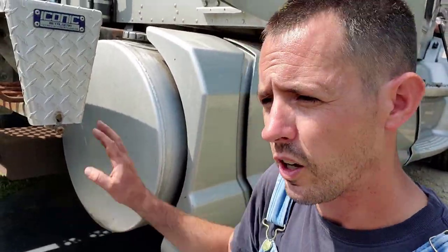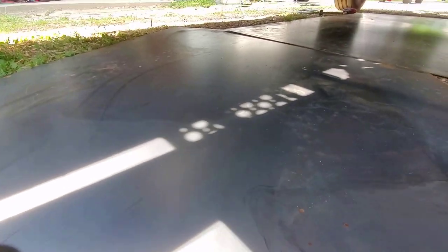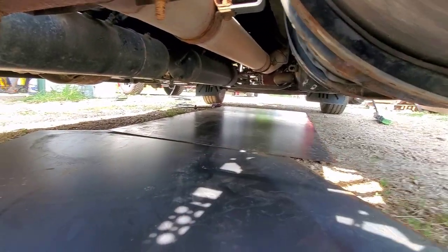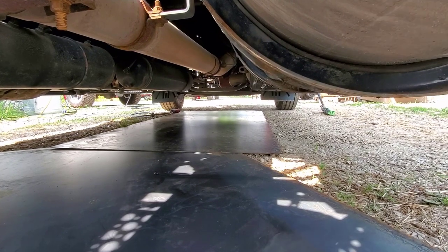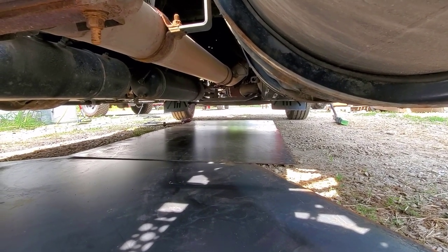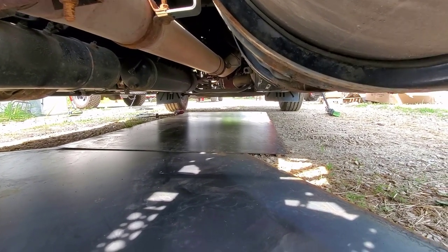I put that down, got the truck level here, put that underneath here. So now we'll go underneath here and show you what I got. All right, go underneath here. I took my chains off the chain hanger here to get those out of the way, because I'm actually going to bring the transmission out. That's why I've kind of angled this back piece so I can get my forks of the front end loader underneath here to grab that transmission out and also set the new one in.